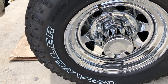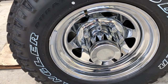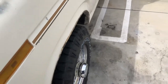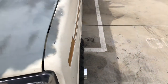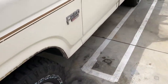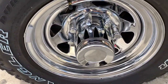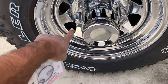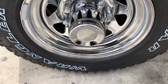The wheels are chrome and they're made by a company called US Wheel. I purchased them from Summit Racing — I'll put the part number in the description. These are 16 by 8s; I went one inch wider, which doesn't hurt. As you can see, they don't stick out hardly at all, which is the look I wanted. The bolt pattern is eight-lug by six and a half — you measure from the center of one stud to the center of the opposite stud. I'll leave part numbers in the description.